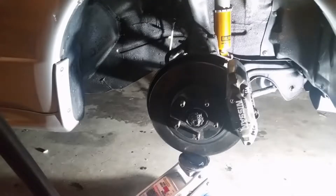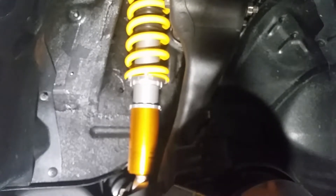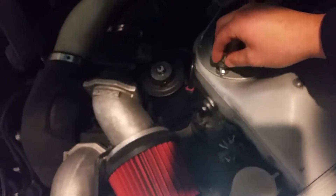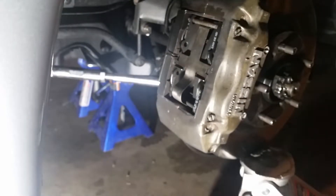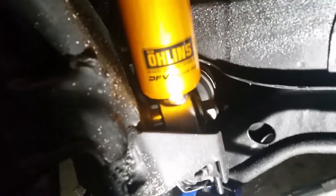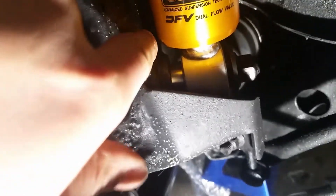Alright, I'm just using my jack underneath the brake and tighten the nuts. The lowering fastening nut needs to be tightened to 75 foot-pounds. Here it is a little bit installed — that's the spacer I was talking about that comes in the package. If you didn't install the spacer, it would be rubbing. So I'm going to get that in, washer and the nut on the outside.